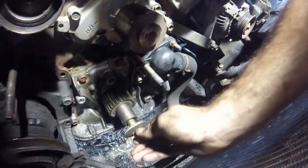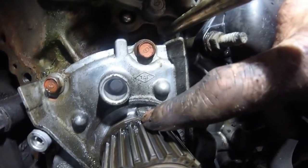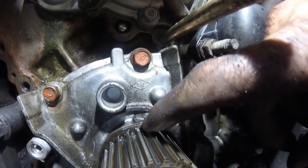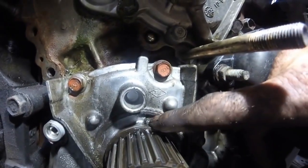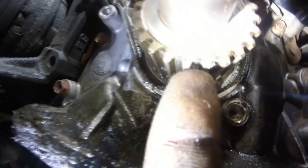Our crank and cams have gotten out of time since we removed the bolt, so we're going to temporarily reinstall the crankshaft bolt to realign the crankshaft pulley. This little mark right here is going to be straight up and point at this line. Lining up that mark with that line will put the keyway slightly off to the left. When you look at the bottom of the pulley you'll see a little dot right there on the bottom — make sure that little dot is on the bottom.